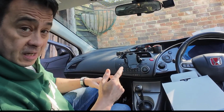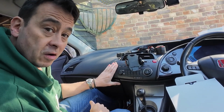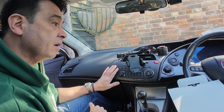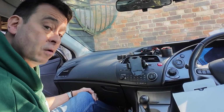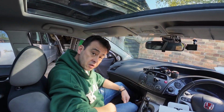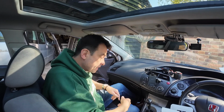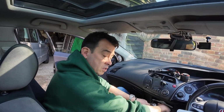Now, if you haven't seen my lovely little video I did on how to remove the stereo on a Honda Civic Mk8, then unfortunately for you, you're going to have to undo a few panels, and that involves taking the armrest out. You've got to remove the armrest. It splits into 2. And once you've got that away, then you can access 2 screws, which are actually sort of hidden behind this little ducket here.